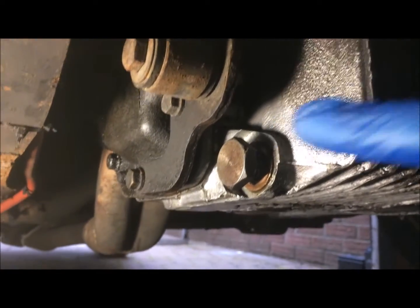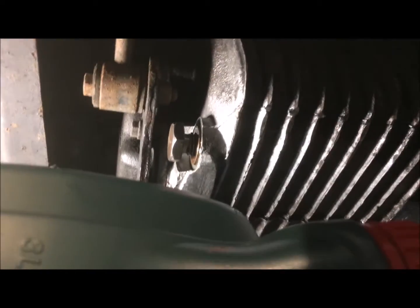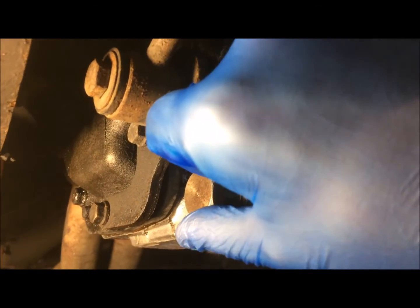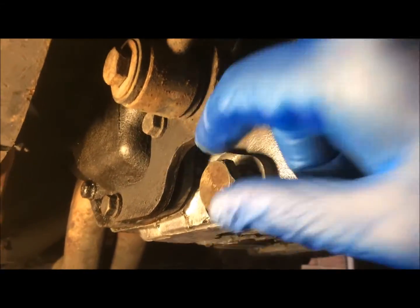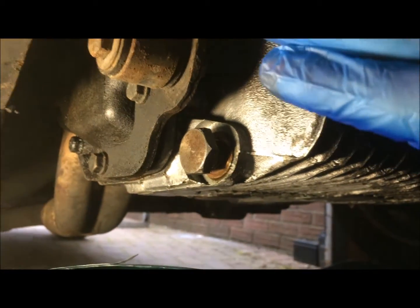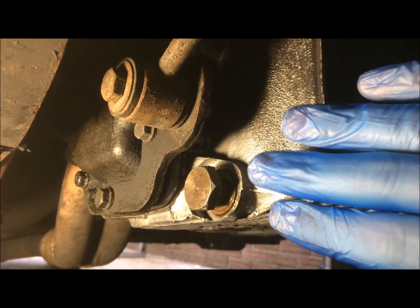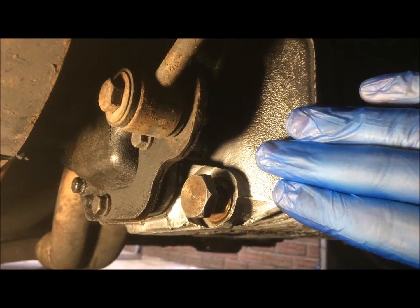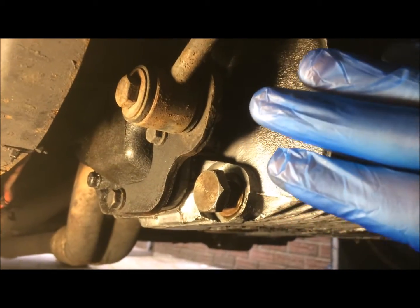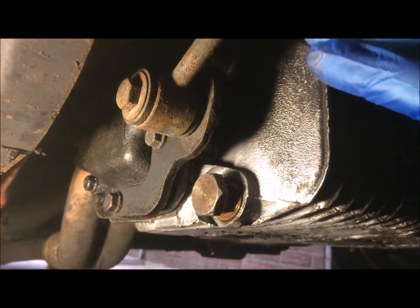Okay, so this is the sump plug. You'll find it at the bottom of your engine on the driver's side. And I've already cracked it off with the ratchet, so it's just finger tight now. I've got my pan set up ready to collect the oil that pops out. Now obviously if you've run your engine for 10 minutes while working the flush through, the engine oil is going to be extremely hot, and apart from that, used engine oil is a known carcinogen, so you really don't want to get any on your skin because A, it will burn you, and B, it's cancerous.